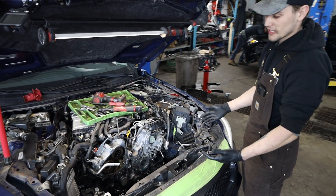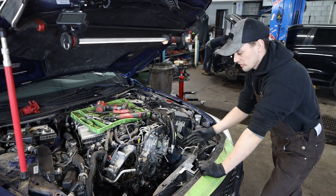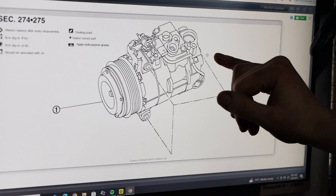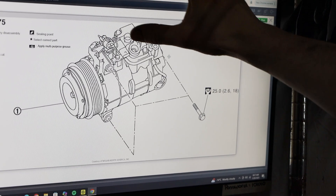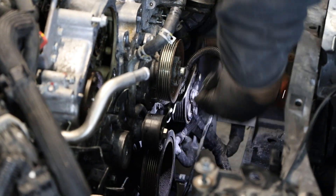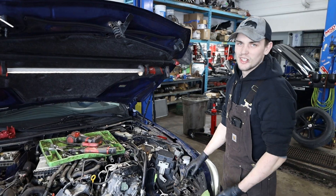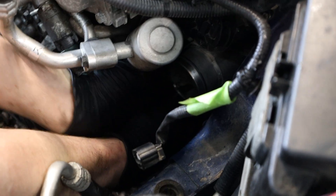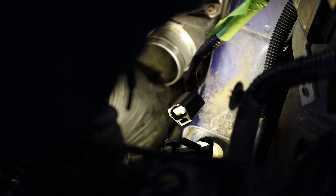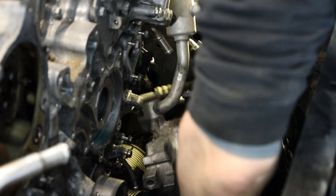What happens whenever you're working on cars like this, you're in limited space. So basically with the AC compressor, most normally there's always two bolts in the front, but on this one there's one in the back. And on this side over here, there's a bolt underneath the turbo on the back of the AC compressor, which is going to be a struggle to try and get out, but we'll get it eventually. The AC compressor was a fight, but you can get it if you use a 3-inch extension and a 12-millimeter socket, and then just a flexible head ratchet helps a lot.